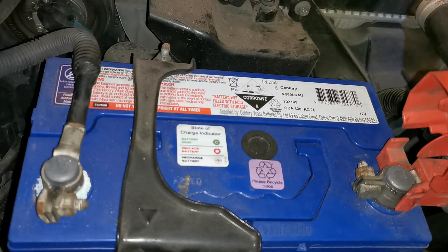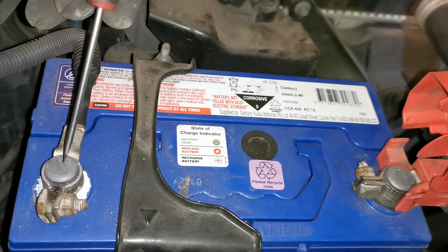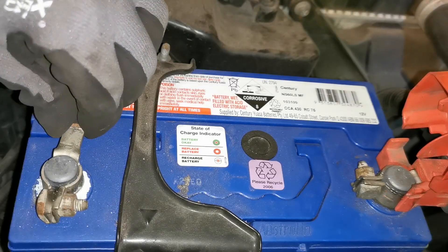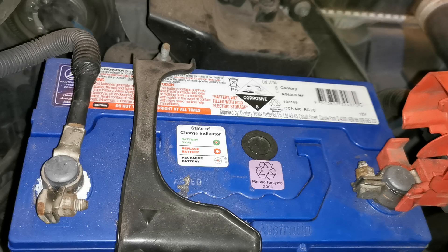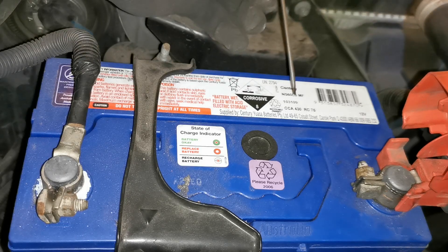You want to check for corrosion - in this case you can see that there's corrosion present over this side down here. You want to check between the battery terminal and the lead itself, make sure it's not loose, and do that on both sides. Once we have those initial checks done, we go on to have a look at the battery reading.